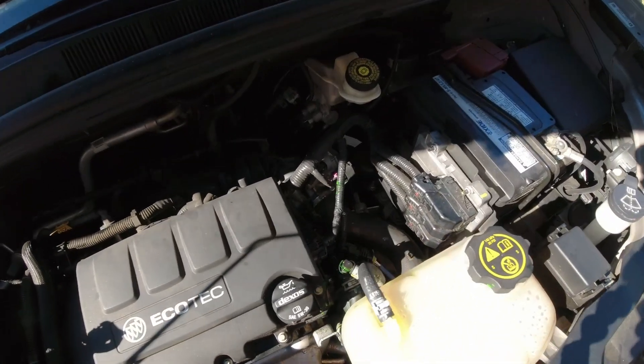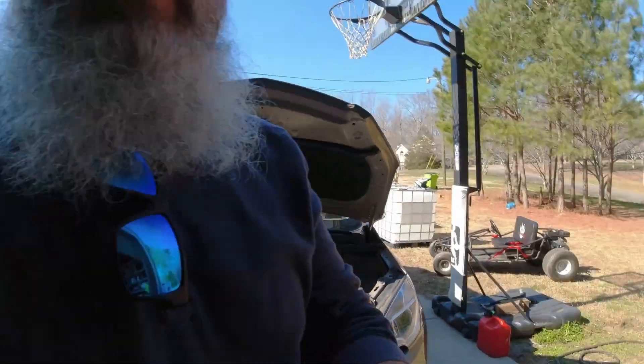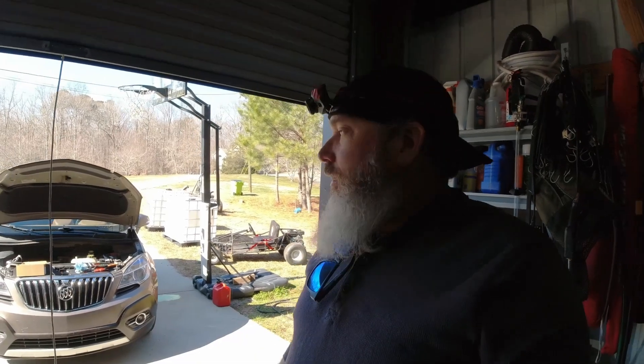We're going to button this thing up, get it cleaned up, and get this lady back on the road. It goes back together fairly quick — it's not that big of a job. If you're trying to do this at home, you can totally do it. You just need a few specialty tools: the inverted torx bits to get the bolts out, and a good pair of radiator hose pliers. Don't try to do it with needle nose or channel locks — you're going to break something or mash a finger. It's even frustrating with the good pliers, so do yourself a favor and get the right tools. All right, we're going to clean this thing up and wrap this video up. I appreciate you watching along — don't forget to give me a thumbs up, leave me a comment, tell me what you think. We appreciate you. See you in the next one. Peace.